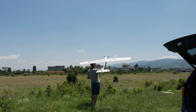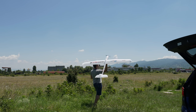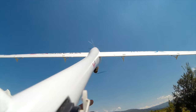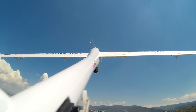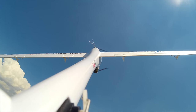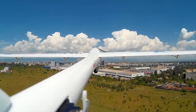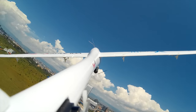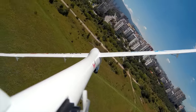On 4S I didn't even have to give it full throttle — around 70% was more than enough and the plane was off, easier than any other plane I've flown recently. I just tossed it at a slightly upward angle without much force and it didn't want to dive down immediately. It did require some up elevator and aileron trim, but after that it was just a dream to fly, and it wouldn't pull to any one side with or without the motor running.